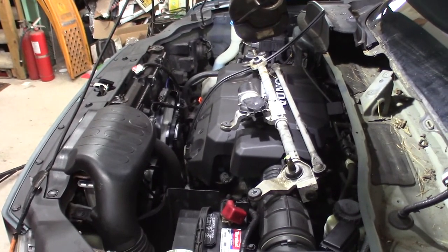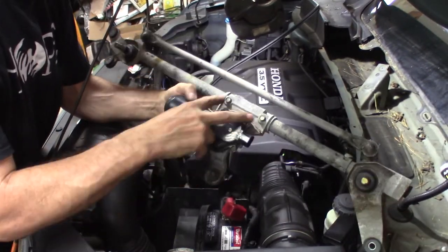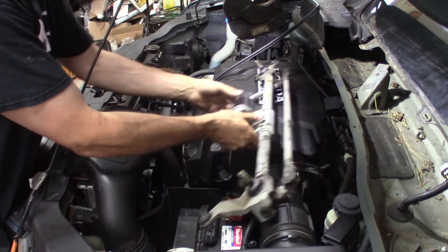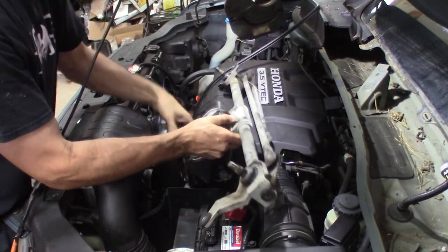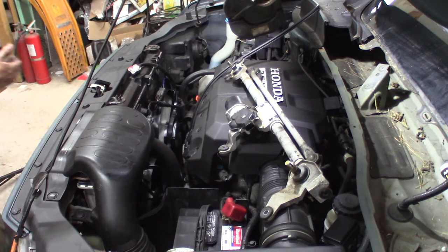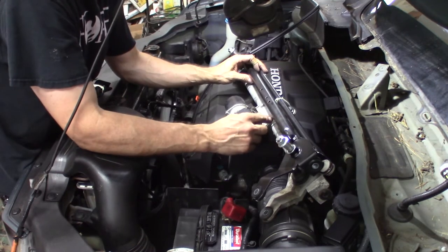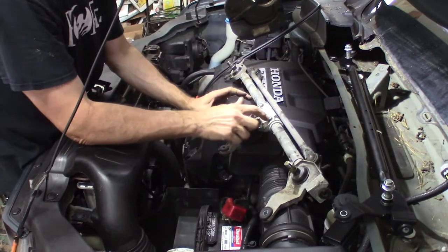We're going to unbolt this, take measurements, and move the motor to the new one. Right up in there — there's a pin right there. You've got to slide the hole to the passenger side once you unbolt it to get off that pin. Here you can see there are two bolts — I'm going to measure this distance. Actually, there might be two holes for this mount so it might not need measurement at all. Let me get the new one and take a look. This is what's broken — there's the arm. You can't get these nylon cups for the ball joint separately; I looked all over and don't think they make them for this car. You've got to buy the whole thing. Here's the new one — looks like there are holes for it, so let's match it up to make sure it's the same. It looks the same — that's a good thing.